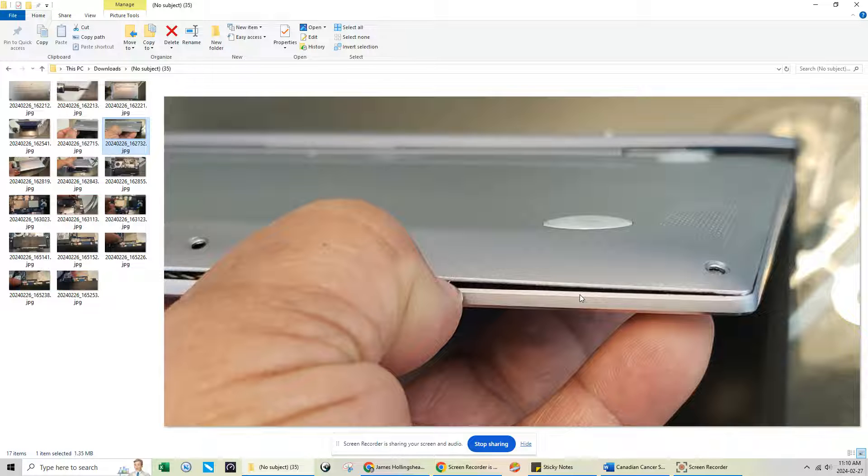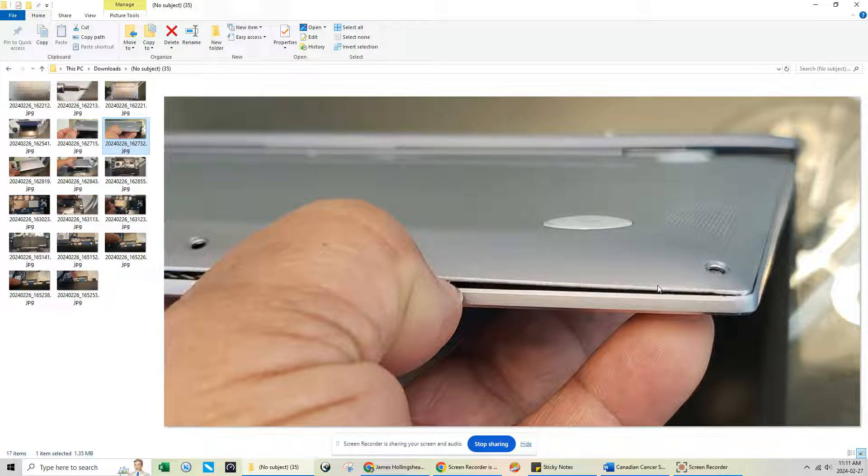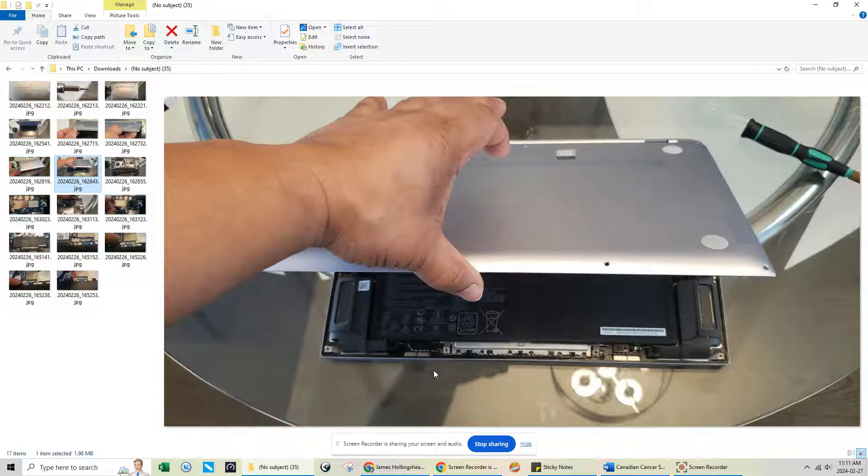This model is a little tight in the bottom-right corner, so you could use a pry tool, but you don't have to. You don't need to run your fingernail all the way down to that corner. Once you have the front left and front right opened up, you can close the laptop back up, making sure that wedge is still there, then just pop it up. With this aluminum chassis the bottom casing is very tough, but as long as you have the front left and front right pried open, you can just lift it up and remove the panel.